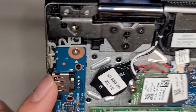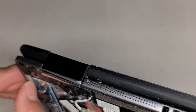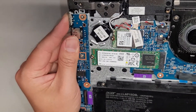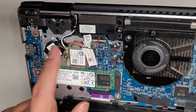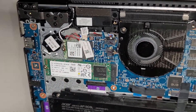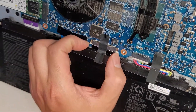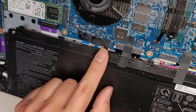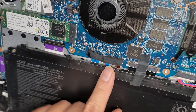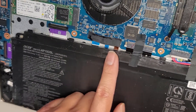I don't think I can get in there because there's a plastic piece right outside, so I can't completely flatten that out, sadly. You got the CMOS BIOS RTC real-time clock battery here with the connector. Wireless card here, wireless antennas. You got the keyboard connector here, which has a little slide back release latch, and the keyboard backlight connector. It looks like there's a fingerprint sensor and this one is probably the touchpad — TP1 — so touchpad and fingerprint sensor.